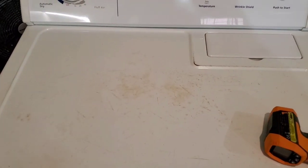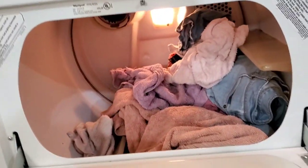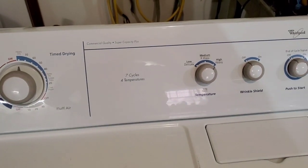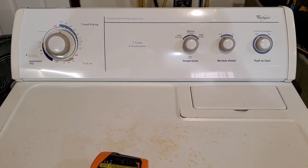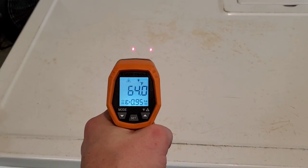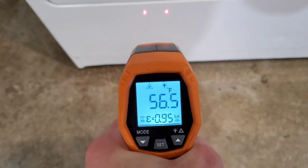We'll do a little touch-up on the top and you'll be able to see that in the pictures — it'll look like new again. We'll go ahead and open this up here, show you the light works good, everything's in there tumbling real good. You can see it starts perfectly, sounds great, nice smooth operation. Then I'm going to show you that it is in fact heating like it's supposed to. Right in between those two red dots it's going to take a Fahrenheit surface temperature measurement. You can see the difference whether I shine it on the floor or up here on the dryer.